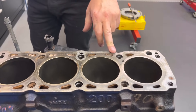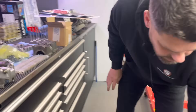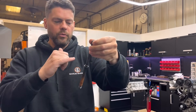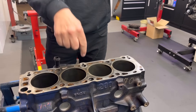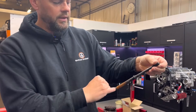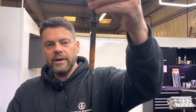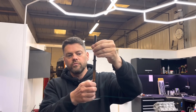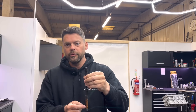It's got the long stud conversion - the old long stud setup - so we're going to have to do a bit of modification. We've got the old style Burton studs which have the seal on there. What we've found is on the opposite side to the oil way we have to go deeper - drill and tap five mil deeper, go another five mil on the 17mm counter bore, so they sit a bit deeper. These have been running about seven or eight threads in the block. It's been okay, hasn't created any issues, but it can just rip those lugs out the bottom of the block.